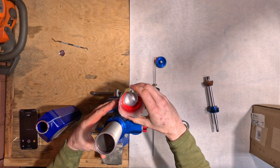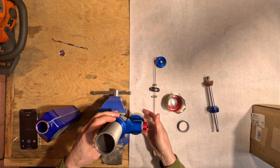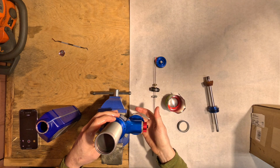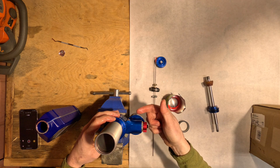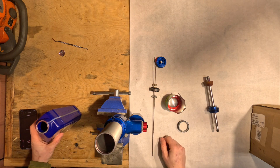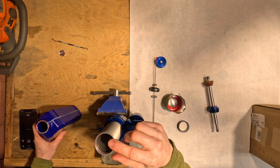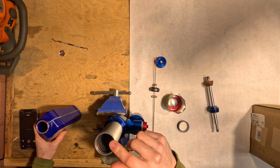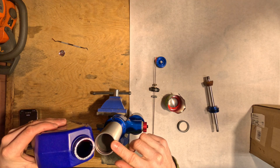I did get a little oil that came through, but I think I cut most of it in there. Sitting in this position, it's holding the oil in the reservoir, so none's bleeding out. All the air should have floated up to the top, which should allow us to purge it out. So now we're just going to top off the cylinder — I can see the ports in there — we're just going to get the oil level a bit above there.